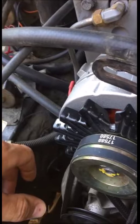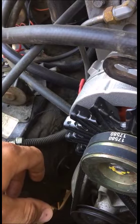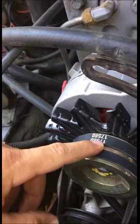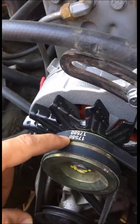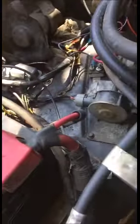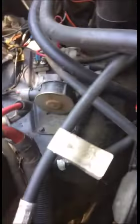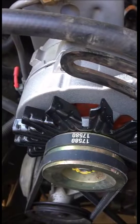I change the voltage regulator from a different parts store, make it another couple of minutes, and this alternator dies - producing plenty of voltage but only about 10 or 11 amps, so it's not doing its job. The voltage regulator is brand new and was fine, but it's just been such a pain that I've decided to swap it out to a 3G. I read up on some forums and some very helpful people gave me advice, so here's how I'm going to do it.